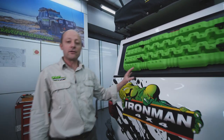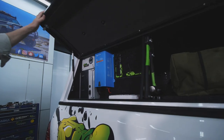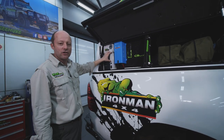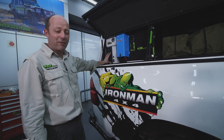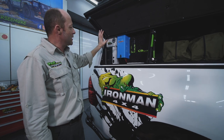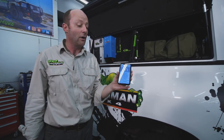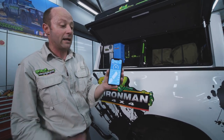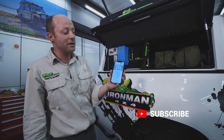The electrical and dual battery system has now been installed in the vehicle. As you can see, it's a very compact and neat install. This is the inverter charger. The DC to DC charger and MPPT solar controller is inside this box here. We have plug points here, and this is the monitor for the Victron system. The nice thing about this Victron Energy system is that it features an app for your iPhone or Android phone so you can see anything and everything going on with the system, whether you're in the vehicle or lying in the rooftop tent at night.